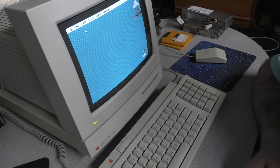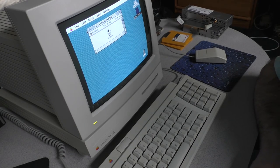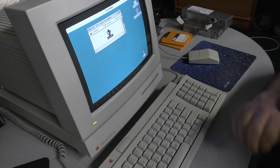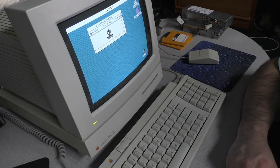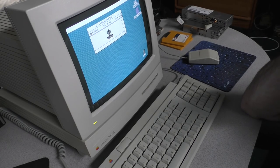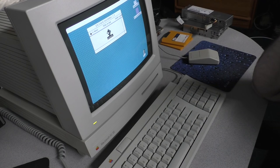The backbone of our network was provided by Digital Equipment Corporation. It was all based on digital equipment: the DEC repeater series of 10BASE-T Ethernet hubs. I think they were hubs; I don't think they were proper switches. Anyway, there were three backbones in the building, three that I knew of. Each one was fully populated with DEC repeater 8-port plug-in modules. It was a whole modular system.